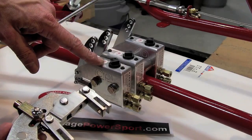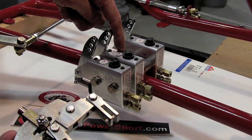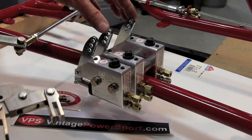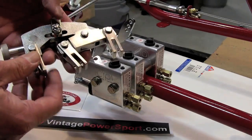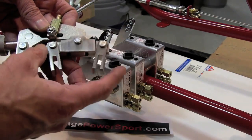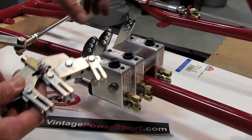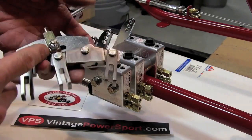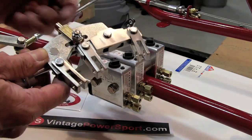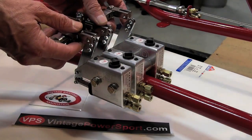There's going to be a master cylinder here for the front brakes, and then independent master cylinders for calipers on the back axle — two calipers on the back axle. I want to balance the rear ones equally. So I made this mechanical balance bar bias control where there's a 50-50 balance for the two rear, and then to adjust the balance between the rear calipers and the front, that's where this balance bar comes in with the adjustable clevis that will move the brake rod back and forth to change the fulcrum point, changing the balance between the front and rear brakes. So this mounts like this.